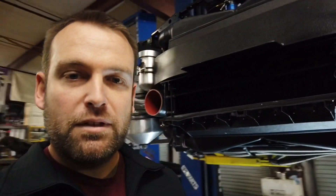One nice thing about this tank, according to Magnus Motorsports, is it's going to take about 25 seconds for the system to pump all of the oil out of this tank and into the motor. So we've got quite a bit of oil reserve in case we had some type of issue where oil wasn't getting back into the tank properly from the engine — we can still supply the engine for more than enough time during a drag pass.